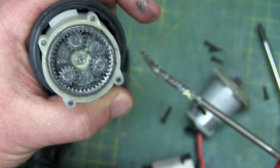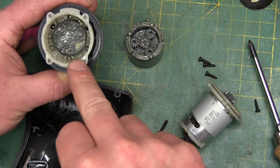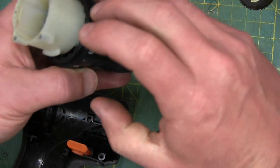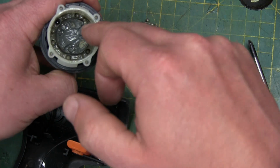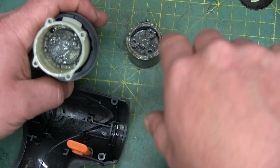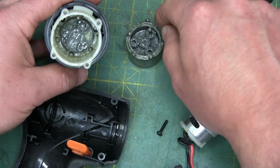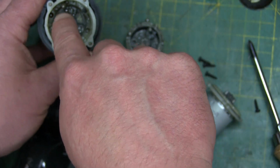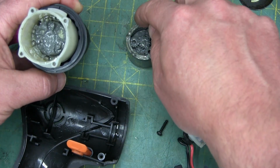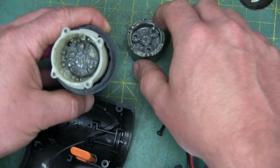See, a very light gray. There we go. I might as well throw her right in the garbage. She's fucked forever now. We can see here, that's the clutch mechanism. Depending on how you turn this, that's preloading some springs heavier or lighter, because it's on a thread, essentially one single ramp thread. And then there's these balls here that ride on the back of those springs, and depending on how hard you preload those springs, it breaks free over these little cams at different torques. So that's essentially all there is to it.